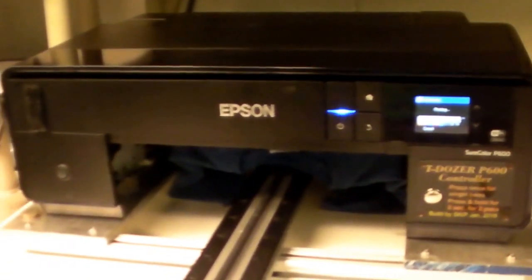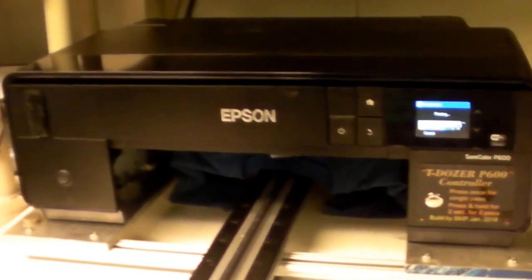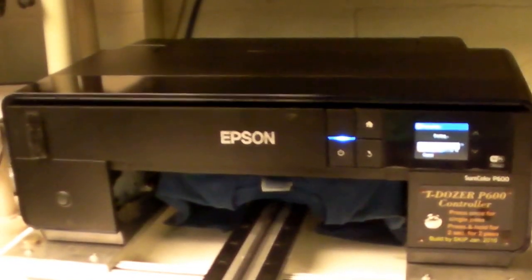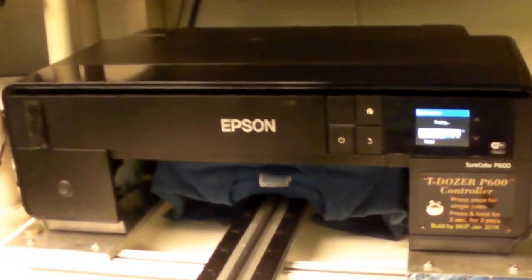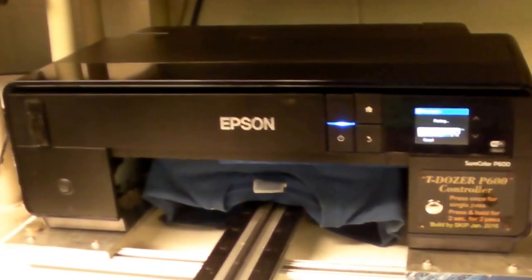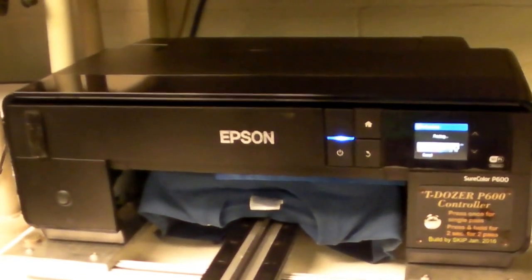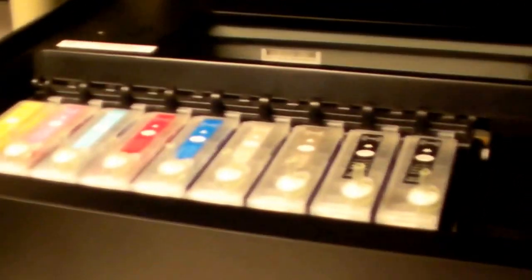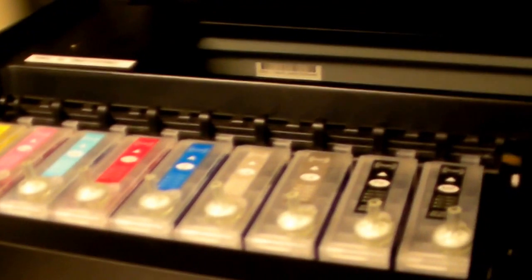I needed the motherboard, but I did not get the ink with it. When I booted up, it said put the ink in it that came with the printer. Called Epson, they said you need new ink. So I had some refillable cartridges. Filled those up — they all got filters. As you can see, it used about half of it to do the initiation.